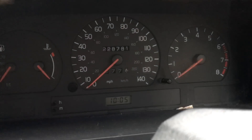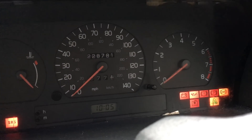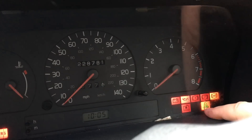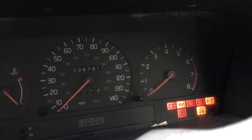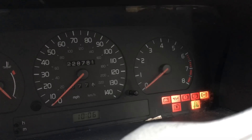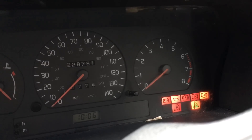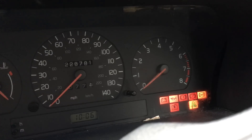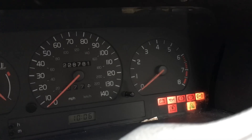I'm going to turn the ignition to the on position - not going any further because I want the engine to be cold. You can see down there that one at the bottom is the check engine light, the fault code lamp. It can come on with cruise control or climate control if fitted, but this vehicle doesn't have those, so it's purely a check engine light. By now it should have gone off and it hasn't, because the fault code is stored in there.